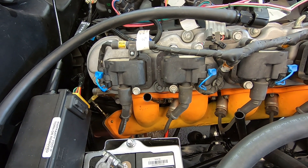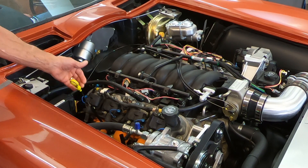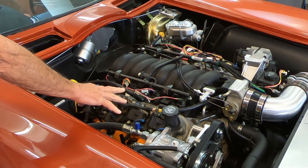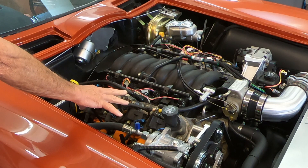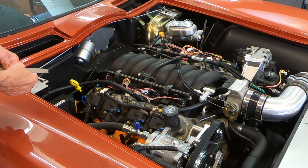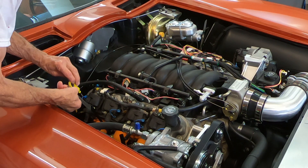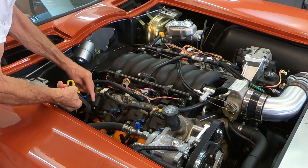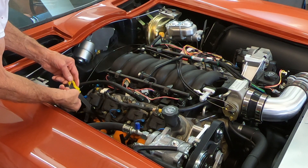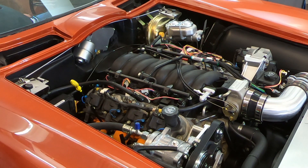So now I need to shorten the dipstick itself. What I've done is by trial and error, moving this dipstick in and out and pulling it out, checking the oil level. I've got fresh oil in it — I put six quarts, which is what it calls for with the filter with the Holley oil pan that I've got. I found the exact location where it registers full, and I'm measuring this distance from the top of the dipstick tube right to the bottom where it seats — it measures three and three-quarters of an inch. So I need to shorten that dipstick three and three-fourths of an inch.